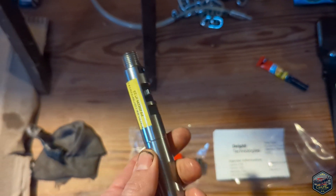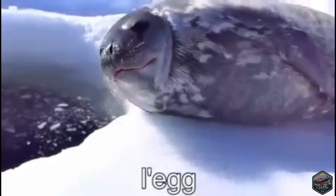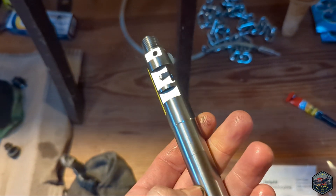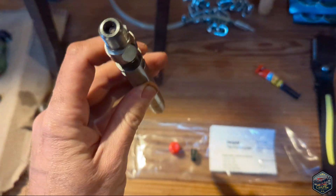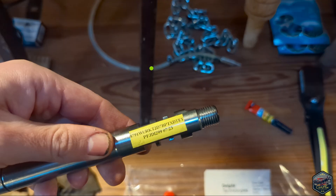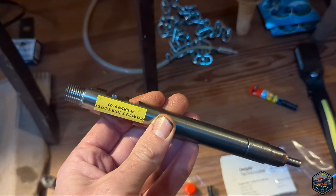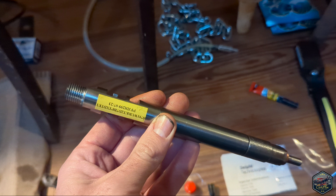The only thing I'm a bit confused about is it didn't come with a seal, so I'm guessing I'll have to stick the old seal back on. Also I can't find a code on it for coding purposes — maybe that's it on the side. Since I had to take the injector back out again, I thought it'd be wise to change the seals for alloy ones rather than copper ones, because I'd heard they're a lot better — the copper just doesn't seem to seal properly between the two other metal types.